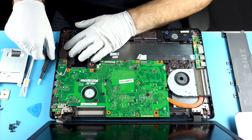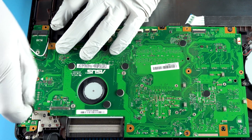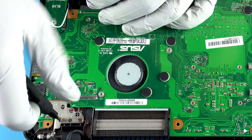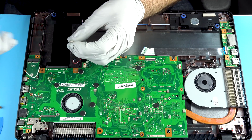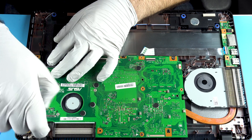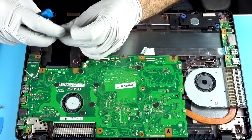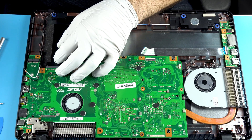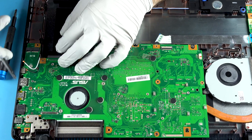This is going to be your hinge for your laptop, but in order to actually get the motherboard out, you're going to have to mess with that joint too. In what situation would you remove your motherboard? If there's some sort of upgrade you want to do — maybe you want to repaste your processor or your video card, maybe you're having heating issues, something along those lines. Otherwise, you pretty much would never want to do this.